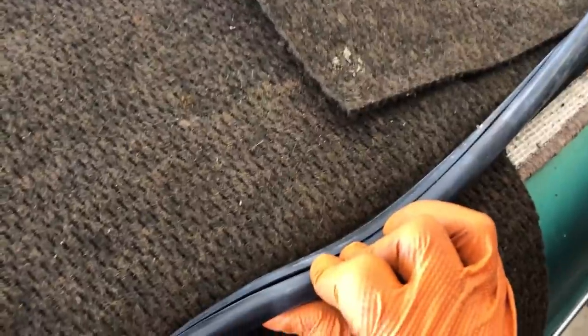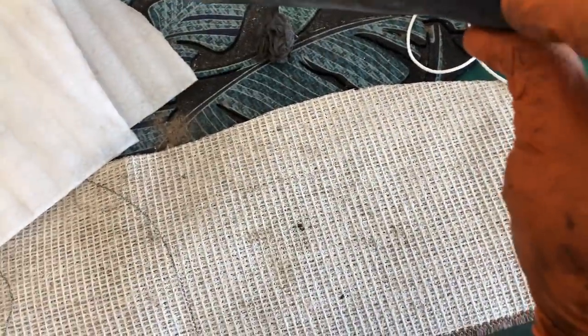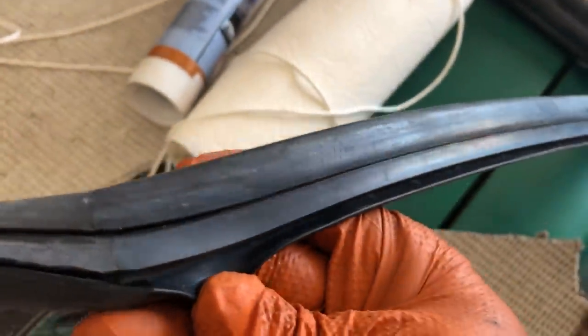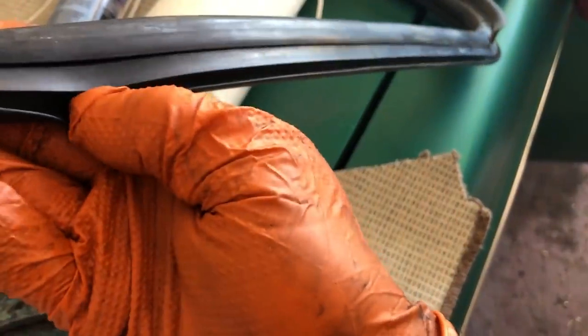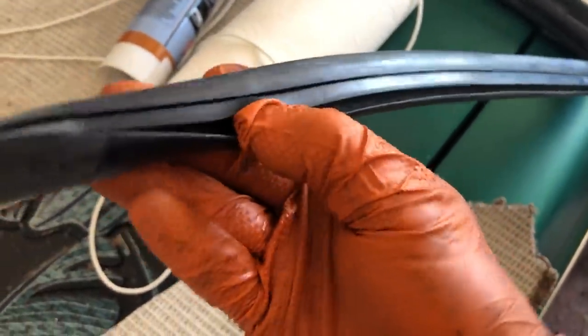Typically, it's not the glass to rubber that fails — not really fails, but leaks. It's the rubber to body. So that's been my experience with the 122s. This is different territory, and as we have noticed, there are some improvements. But overall, it's still a pretty basic style metal frame, so you can't have too much sealant about that. Concerning the second cutout — the deeper one is the one that you put into the rope, and then the rope to the frame. The second one is just a sort of a layer that sits on this groove, because it is kind of a deep channel. So that goes there, and then essentially there's a flap underneath it that is free until the trim is installed. So I will rope in this one, and then I'll glue in this one after the fact.